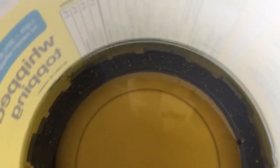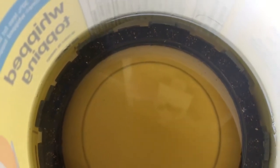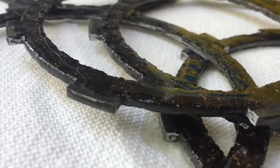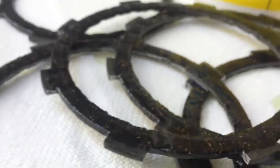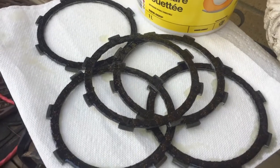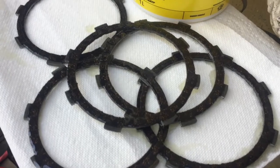There's not much more I can do here now until I order the new parts. So I have my new clutch plates — they've been soaking in oil for several days now because I haven't had time to get to this. These friction plates don't look a lot different than the ones I took out. I'm thinking maybe the wrong oil was put in the clutch at one point in time and started causing the slipping.